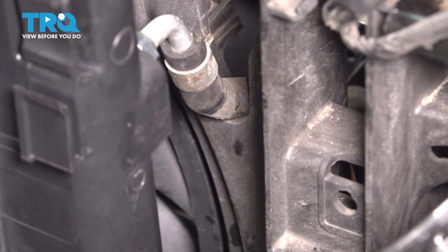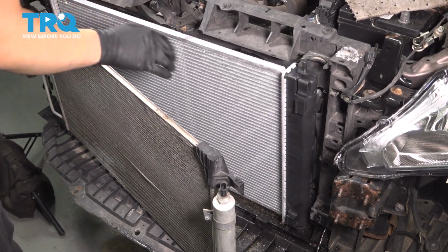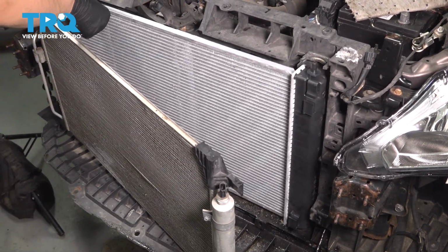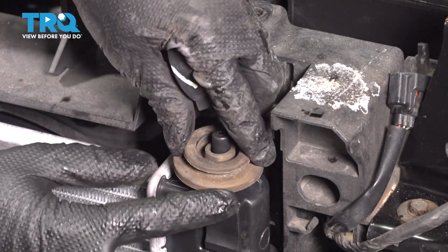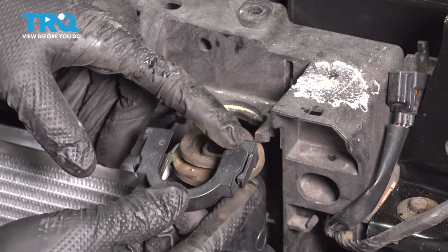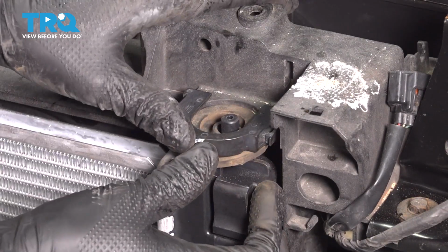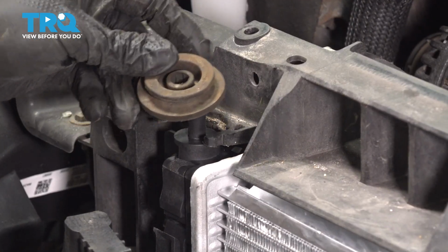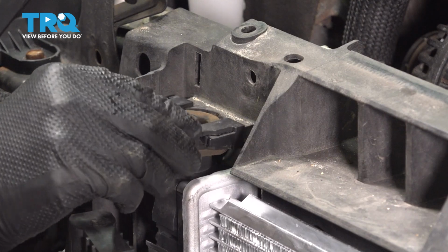And right there, perfect. Reposition the radiator on those two lower grommets on both sides. Make sure it drops in. Let's lock it in on the top by installing these grommets with the wider part facing down, and the brackets say up on the top side. So slide those on and lock them in. Do the same on the other side.